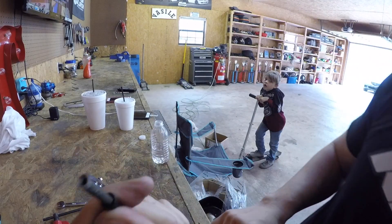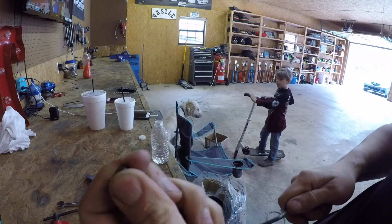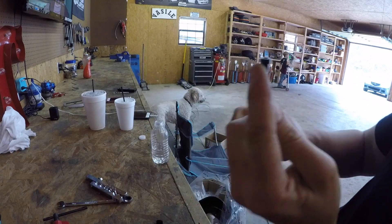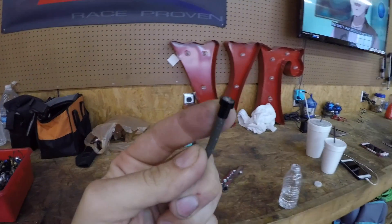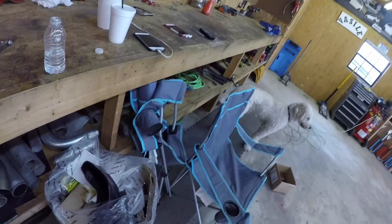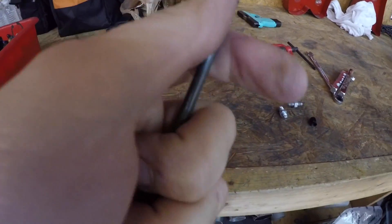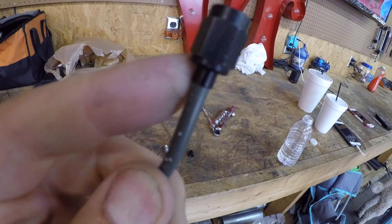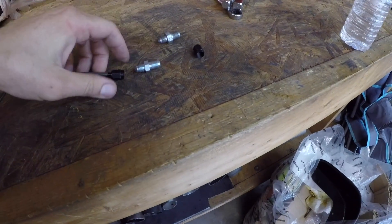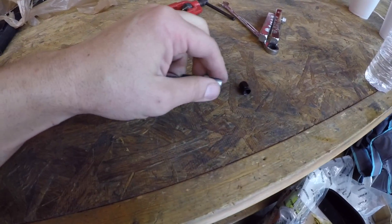Got the line right there — see that line. If you can tell, it's flared, and you just push your fitting up — see that. The piece I just slid on goes right in. I think if I put it right here you can probably see better — see that. And then once you do that, you have this other piece that goes over — see that — and that's where your brake line is gonna go in.